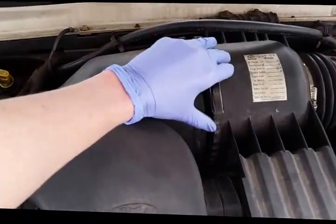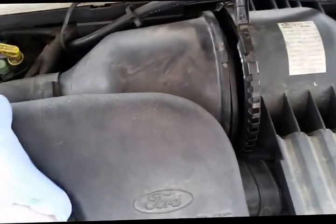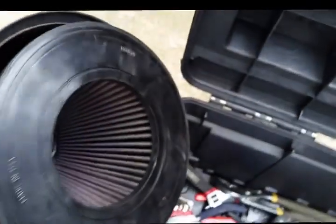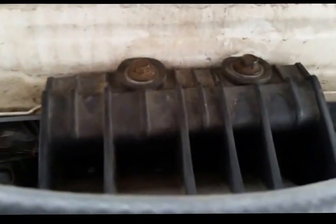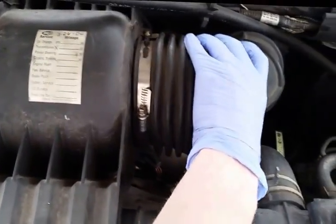Here what we've done is we've lifted the latch here, which releases this mechanism. You can pull out the air intake — it just slides right out there. There's your air filter, so if you do need to replace or clean that air filter, that's how you do so. Now that we've got that off, we've got four bolts in our way to continue, two here and two there. We'll be pulling out this piece and then going here to pull off this rubber hose.